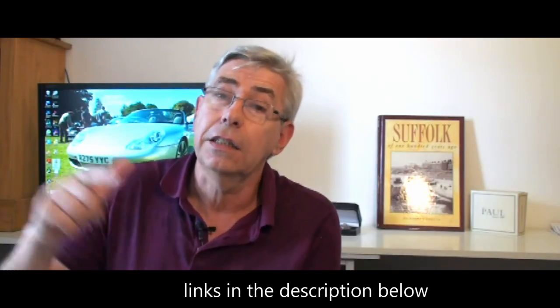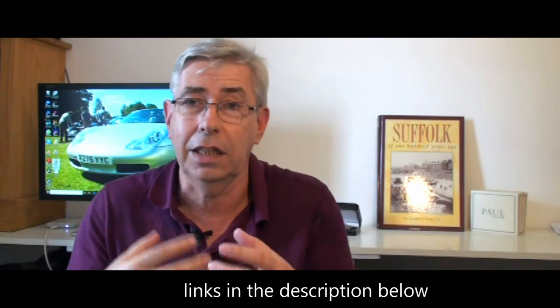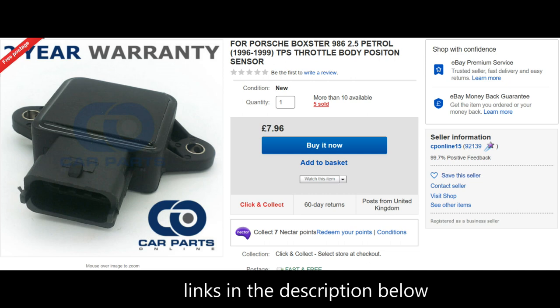The next one is the e-gas - it's like a motor solenoid, or what they call a servo unit, on the side of the throttle body. It looks like you have to buy the whole throttle body, so it's not cheap. That's the one for the electronic throttle for cars 99 onwards. So that is the difference: if you've got the cable-operated one you want the small throttle position sensor; if you've got the e-gas without a throttle cable, you're going to want the whole throttle body assembly with the servo on it.